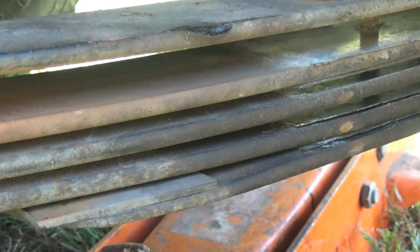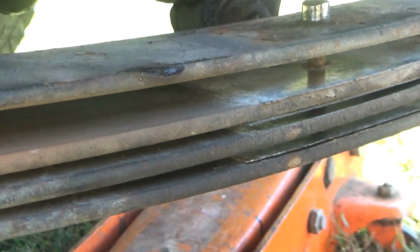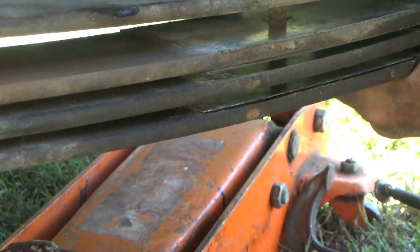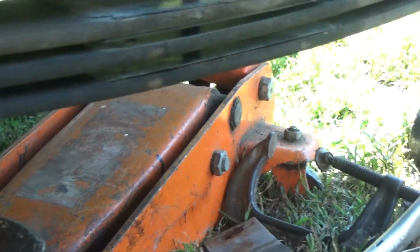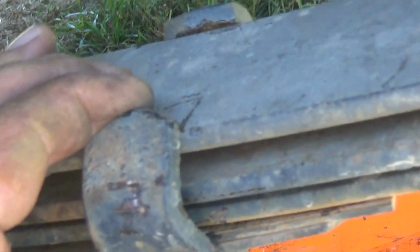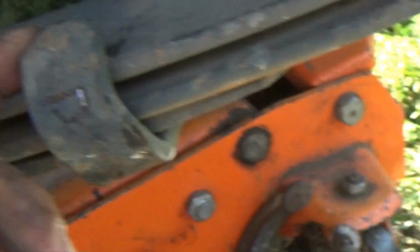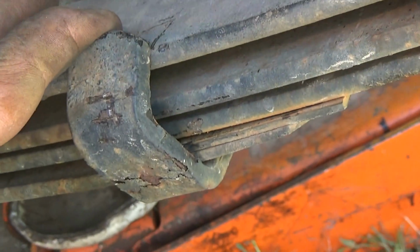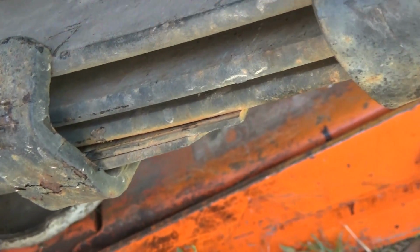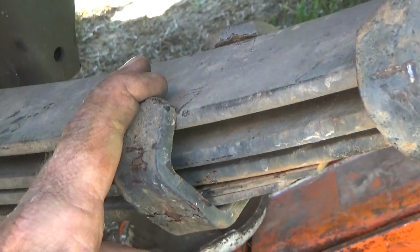See, our bottom one's about out. We got all the pressure off the leaves now. You just have to take that one out. Now, all of our pressure's off, but see, that leaf moves okay. But one thing we do have coming on over here, which is not a big deal, our strap here needs a little bit extra massaging, but if it was pulled over this way, it'll fall off. And the same goes for this right here. They're not under any real pressure, so it's not going to hurt anything for me to put the pry bar here, pull back on it, and it'll pop that leaf on down, and the rest of the pack should pretty well fall apart. So I'm going to separate that and drop the rest of the pack.